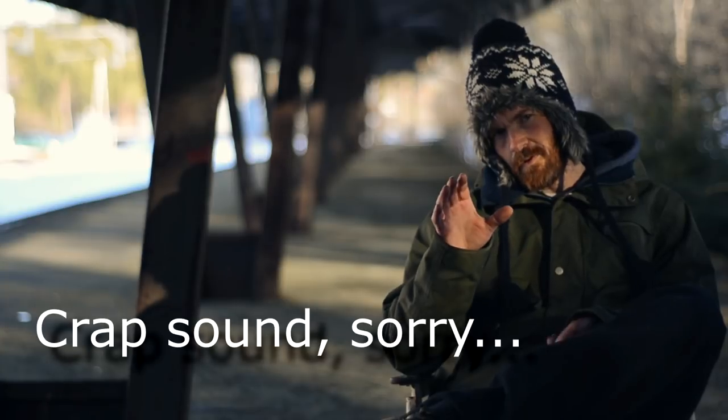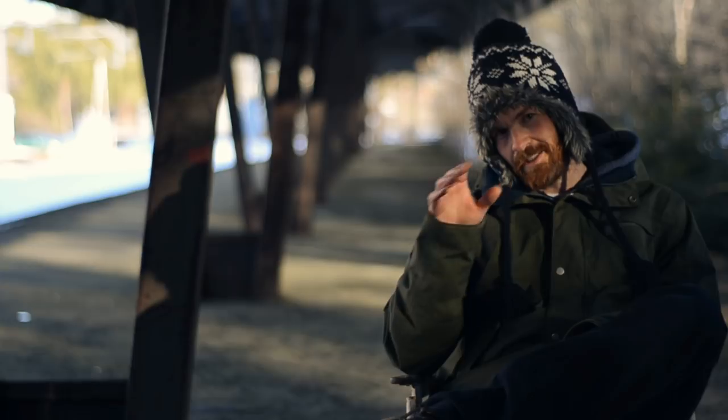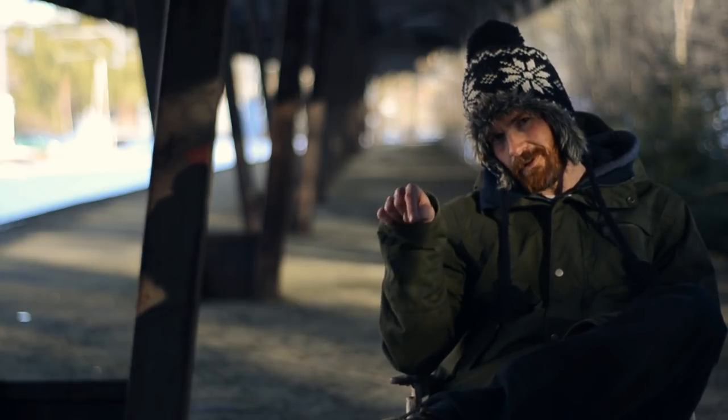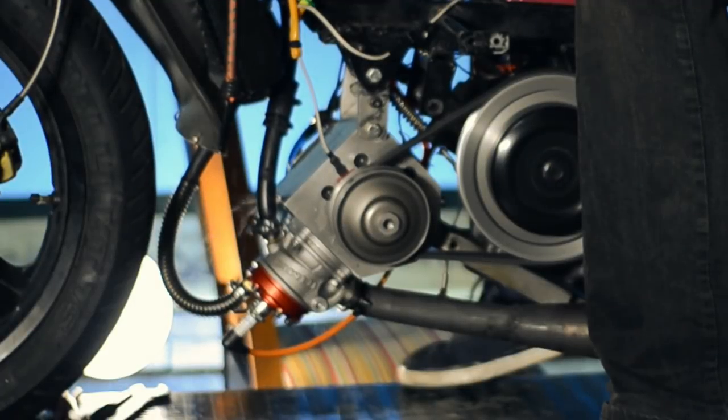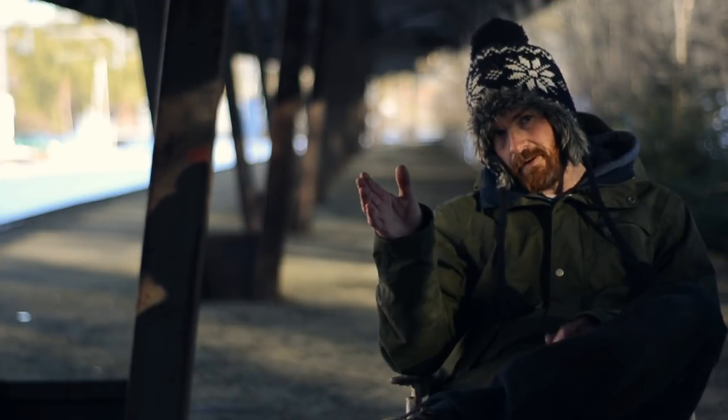But wait. First of all, I think jetting is not there yet. I'm also pretty sure fuel frothing is becoming a problem at the higher RPM, and ignition timing is probably too retarded. I was focused on the temperature gauges to make sure nothing went wrong, and I actually didn't notice what was going on down at the car. Jetting is probably not totally right, and timing is probably off a bit too.